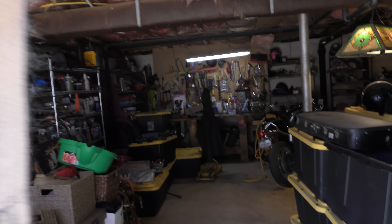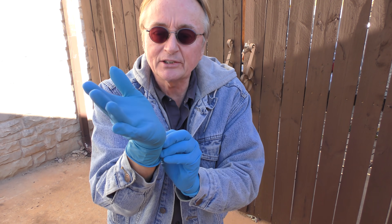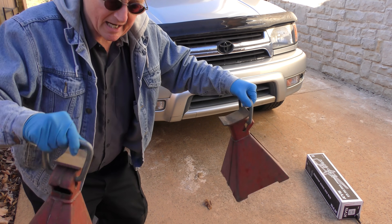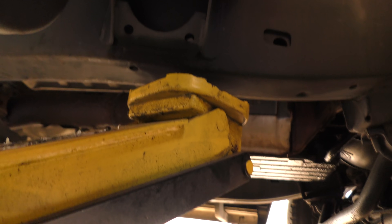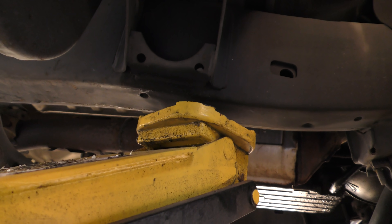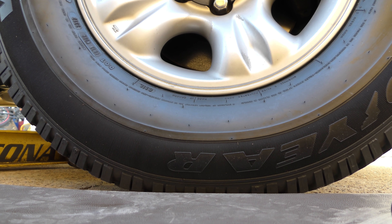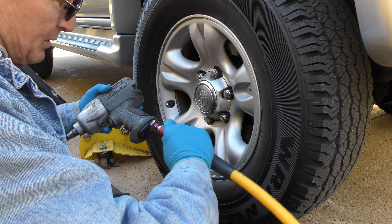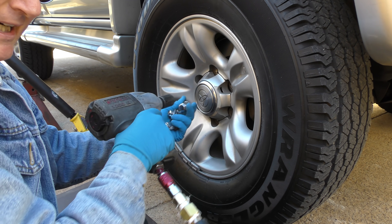So we'll mosey into my garage, pass the dog flap, fire up the compressor, put on the old gloves — it's a little cold and I don't like getting dirty anyway, I'm a strange mechanic. Roll out the old jack, throw the mat down, get out the jack stands. When you're jacking up a vehicle, you want a solid point to jack it on. This has a solid frame, so it's very easy — you just jack it up on the frame. Since we're doing the front ones, you jack it up until the front wheel comes off the ground.